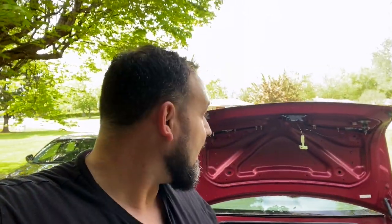Welcome back. I just got the trunk lid swapped out from the red donor car onto my car. That's a job that probably would have been easier with two people, but certainly manageable alone. It's really not that hard to get a trunk lid off — you take the inner liner off with just a bunch of push buttons and a little pull handle, pop all the wires off which are just clipped in place, then unattach it from the hinges and there you go. Simple as that. I haven't gone through the process of trying to get this lined up yet, so let me show you what I've got to do next.